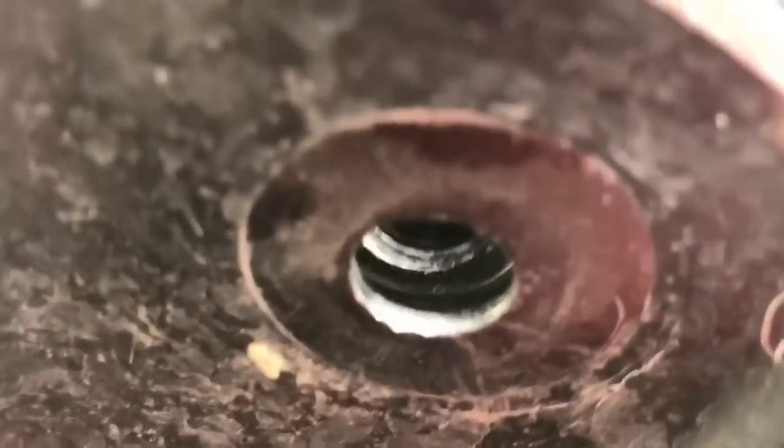All right, so I just went ahead and dropped it. What had happened is I've hit my gas tank skid enough that it has warped just enough to misset like that. So what I'm really going to do is just make the hole a little bit bigger in the skid, so I can easily bolt it back in. So let's drill out some steel.